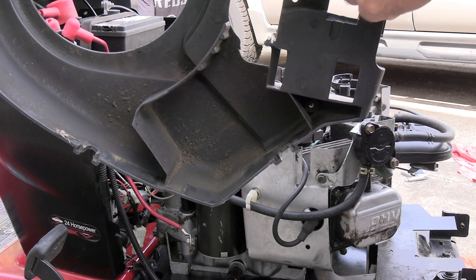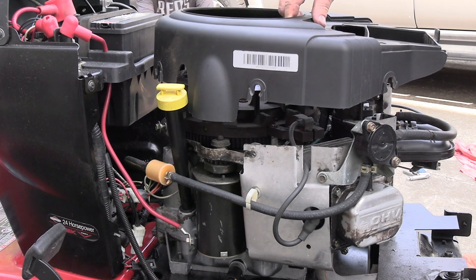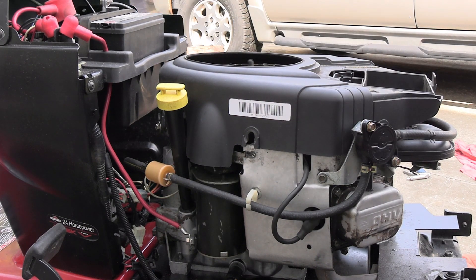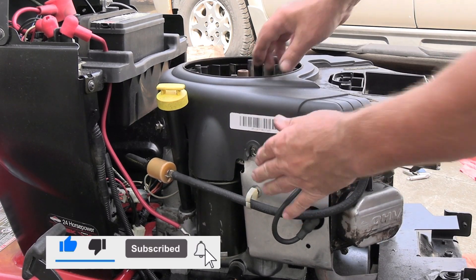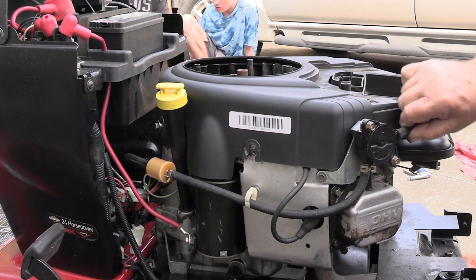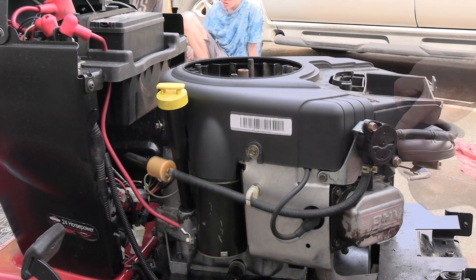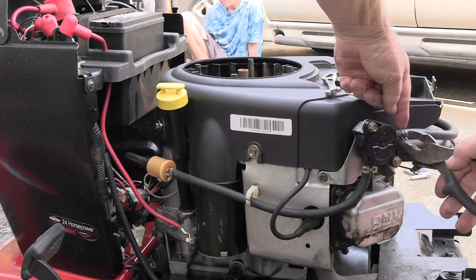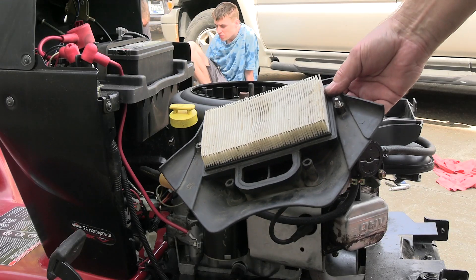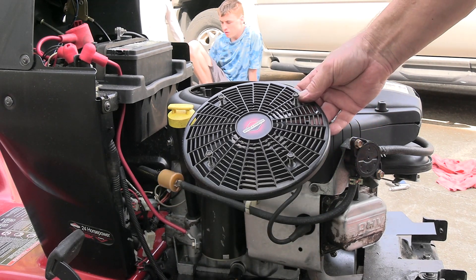This has got grooves in it right here — they go in right here, so it'll fall right in place. Just get it lined up right here, then go around it and make sure everything's in place — pushed in. Do that on both sides and put the bolts in. You may have to take this hose off to get this next bolt in — you can try with the hose on there, but you might break it. Go ahead and put your clamp back on. Make sure you're tying these back ones up — back here you've got two of them. Filter on top. Now go ahead and put our last piece on there — that's for our air intake.